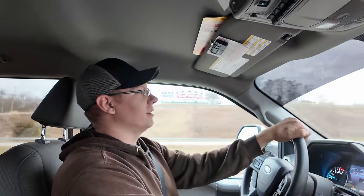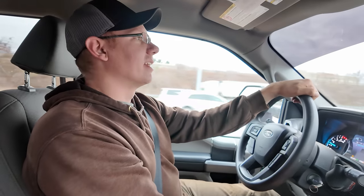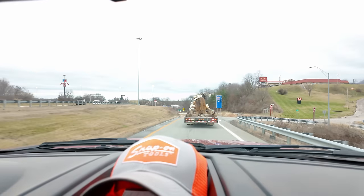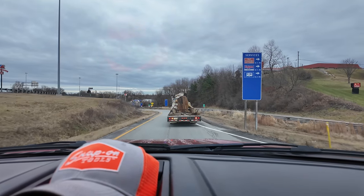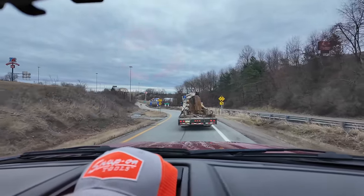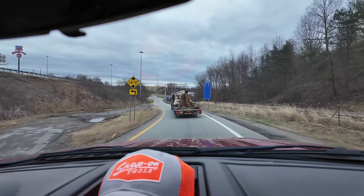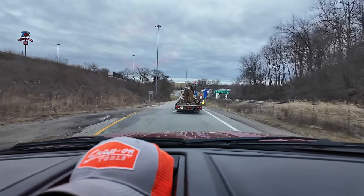What's going on? Well, we just climbed a hill at traffic speed, which is not like Sam. Normally Sam is just hammer down. The old kitty cat's turned up pretty hot. And he actually had to put his four-ways on, so something's definitely wrong for Sam. He says he's making boost, but not enough boost. It's down to about 15 pounds, so he's thinking we got a hole in a boost hose or something like that. We're pulling off and gonna have a little look-see.